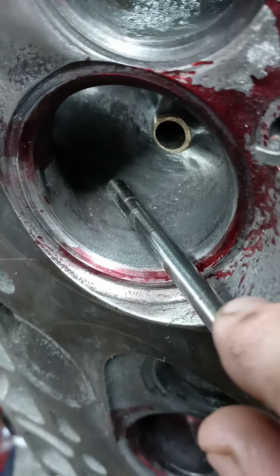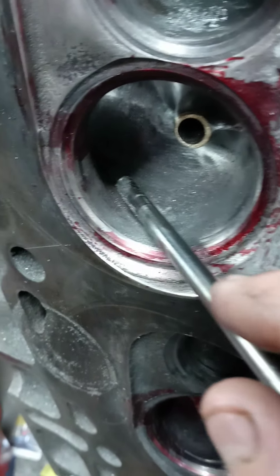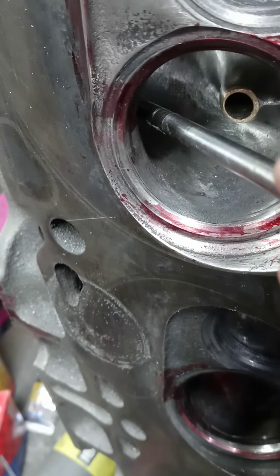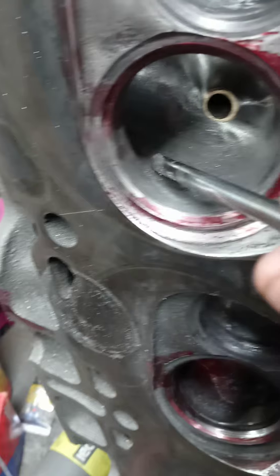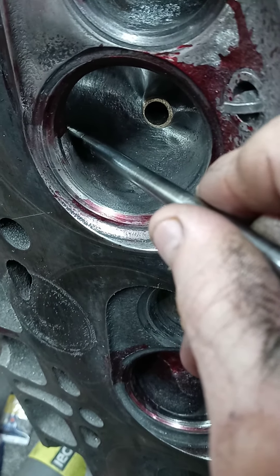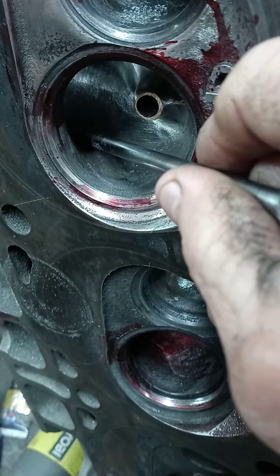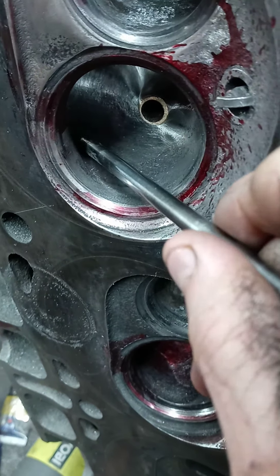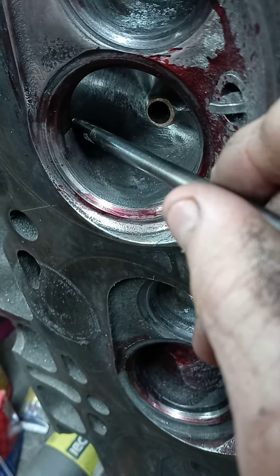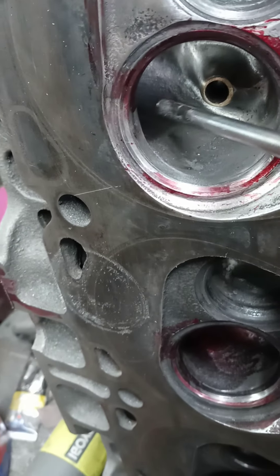The floor is actually straight. I didn't take this floor raised all the way to the back — I left it halfway. I filled it in where the floor had the oval port and it drops down there; I just leveled it out where it widens into the bowl. So all I basically did is even the floor out and raised the roof as much as I could, where I don't want it to be any bigger than necessary — just tried to give it the tunnel effect.